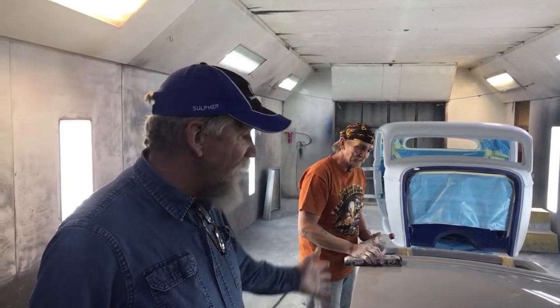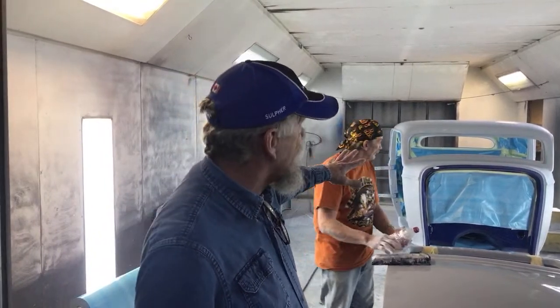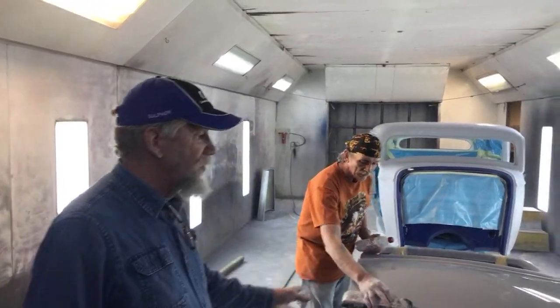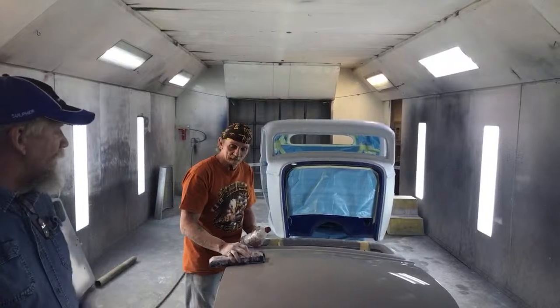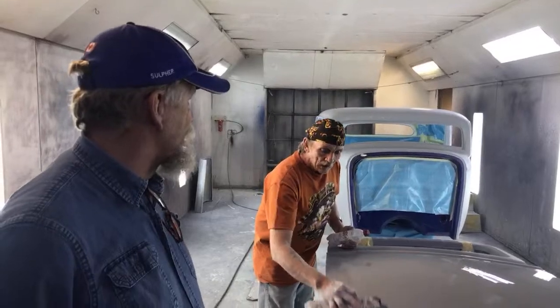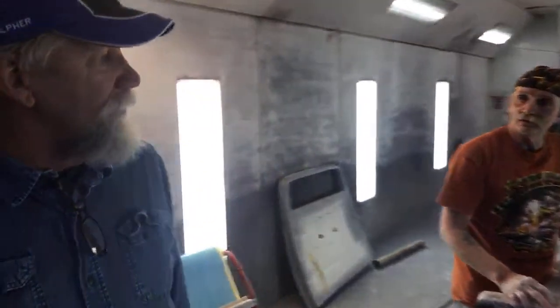So you're on the final blocking on the doors. The body's done. So on the blocking part, surely you're not 220. You're 400. You're 600. What are you finishing? 400. And why 400? Why not 600? Well, 600, I don't believe paint will stick to the adhesive because you can buff it out. If you buff out at 600 to scratch, I don't believe paint's going to stick to it and peel off. I agree. I personally think 600 is too fine. Yeah. 400 is fine, but you're going to seal it. Yes, sir. If you weren't going to seal it, I would wonder.